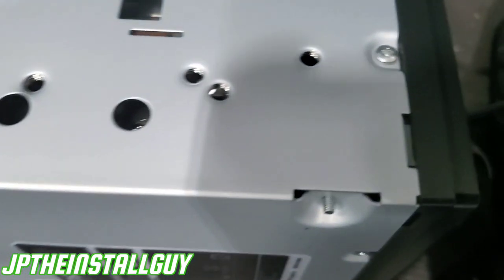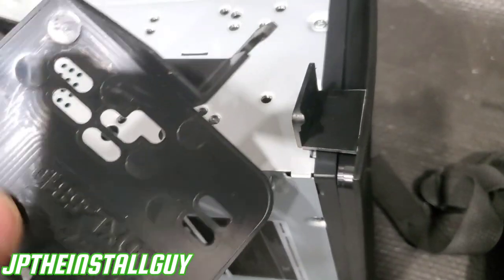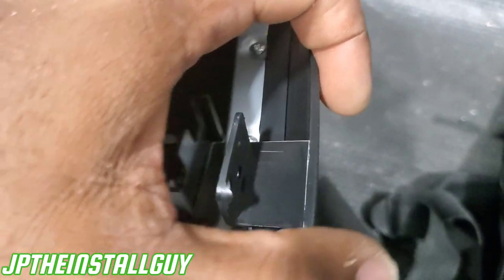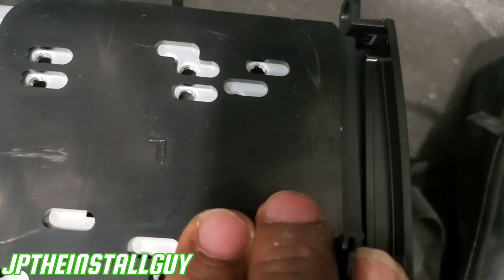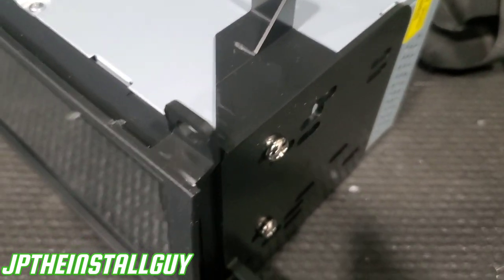On the left side, we have the dash kit sitting like that and we know we want this part at the top. Take that, slide this up, and just hold it together in place. Put that back on the part and now we know our holes line up right here — that's where we want to put two screws on both sides. Now that we've done both sides, this is what it looks like, similar to the factory radio. Let's go ahead and get this thing wired up and get back inside the car.